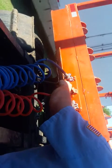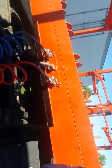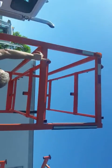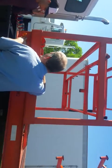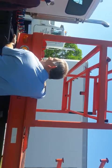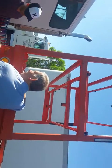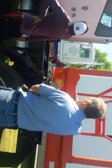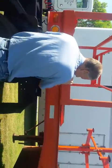Check your trailer supply wire. Make sure it's properly connected, no bare broken wires. All right, right here, 3 foot of frame, cracks, broken welds, missing broken bolts. Right here, you got clearance lights. They're amber. You've got to make sure they're clean, they're proper working order. Lights have wires. You're going to check wires. Make sure they're properly connected, no bare broken wires. Make sure your amber reflector is not broken and clean.